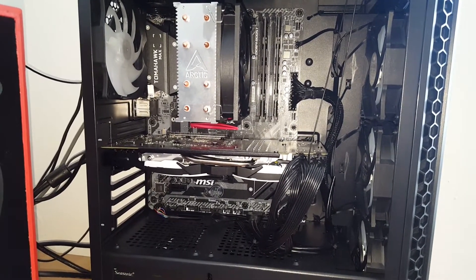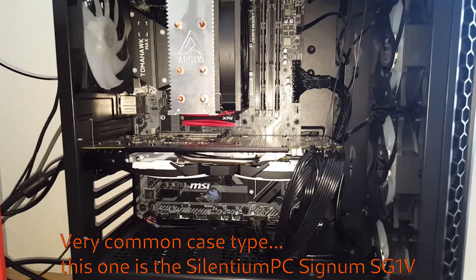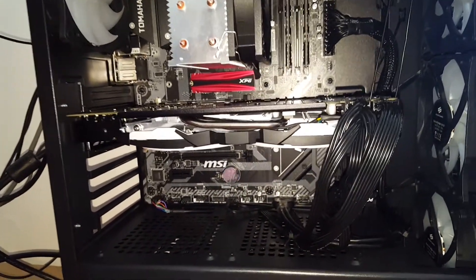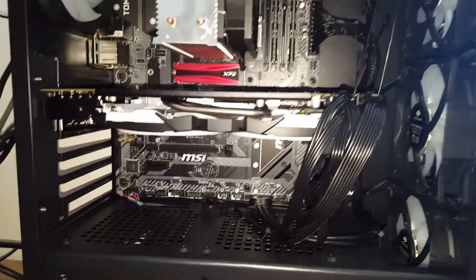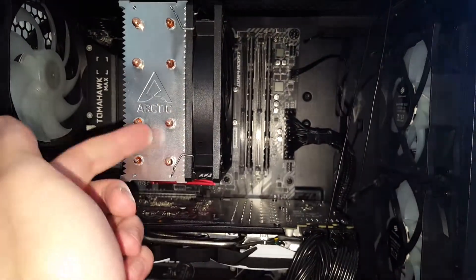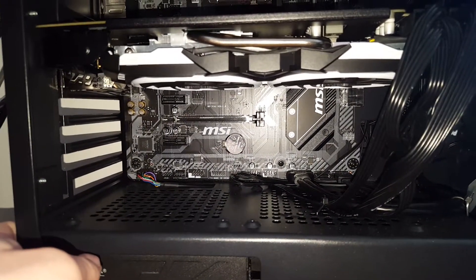Hey everyone, I got this PC — it's a pretty standard case with three intake fans and one exhaust, 120 millimeters. One thing that bothers me is that these PCIe slots were just completely covered. The intake fans pull air in nicely for the CPU heatsink, but for the GPU the air just stagnates there and the GPU ends up recycling its own air, which is obviously not a good configuration.